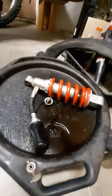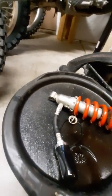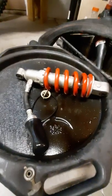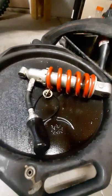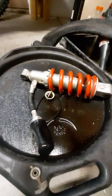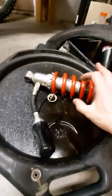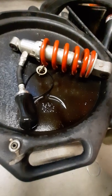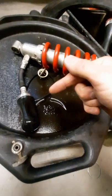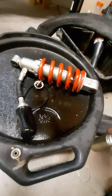It doesn't feel bad and I'm not complaining - it's a sport bike, or at least a sport touring bike. ATF might give lighter compression and lighter rebound, all within what I consider acceptable. Maybe I'll make another video when I do that. The spring's got to come off, the cap's got to come off, and the seal head - I'm pretty sure there is one - you have to compress that in. You can't do anything until pressure has been released from the reservoir. On a conventional bike you just press the Schrader valve; on this thing there wasn't a whole lot of pressure to begin with.